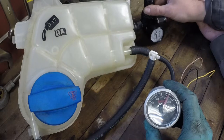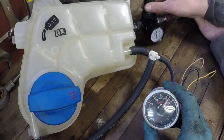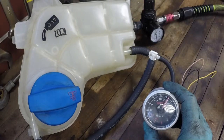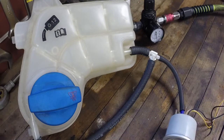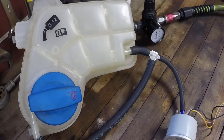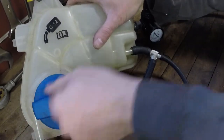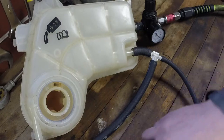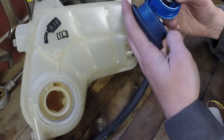There's some kind of weird action. I should mention that when we jerry-rigged this thing up and did the test on the first go-around, the cap didn't open until we think like a much higher pressure. We think it was maybe just stuck closed, but we didn't have it set up with a boost gauge — we didn't have any of that. We just kind of capped the ports off by hand and fed some air to it. And then after it opened, it started to do this kind of strange popping thing.